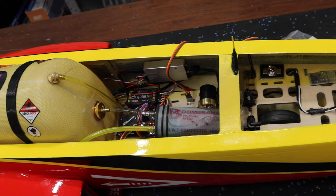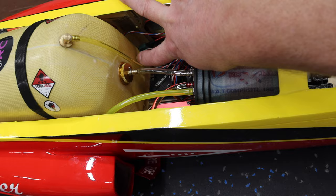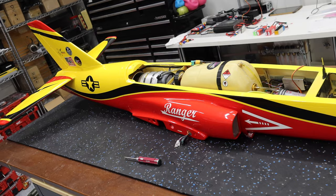We've got two strips — or one full strip — of lead in the nose, and the aircraft is perfectly balanced right now with about a quarter tank of fuel, which is probably what we'll be landing with. We may be able to pull that lead out, but that's what we're using for our CG. So let's get this plane put together and we'll talk more about the installation of the Sky Candy landing lights and lighting system.